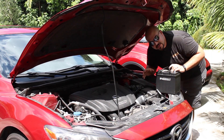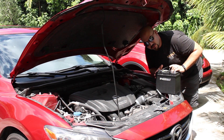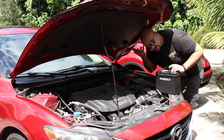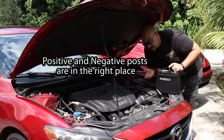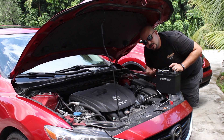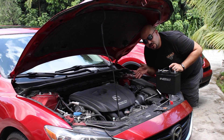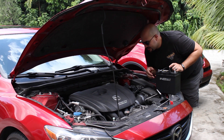To make your battery installation as easy as possible, before I left the store I made sure the battery was the same dimension. There's a group number and everything, but just to be on the safe side — sometimes batteries can mirror. Make sure the battery's the same size and the orientation of the posts is the same. Some cars, when you pull them up in the system at Advance Auto, AutoZone, or Pep Boys, can call for more than one size or type depending on engine option. Just make sure the battery you take in fits your car and is the same size you leave with — that makes reinstalling it a lot easier.